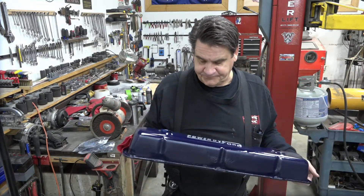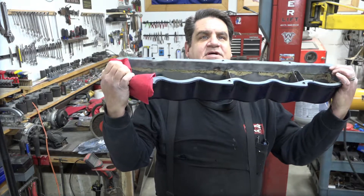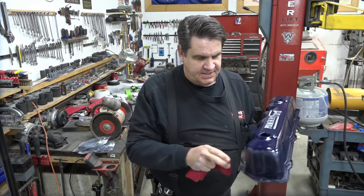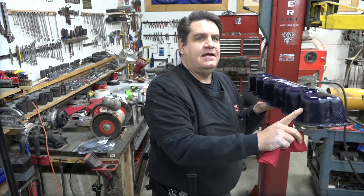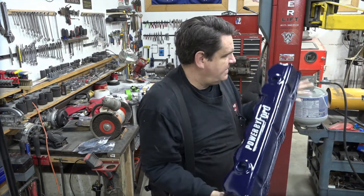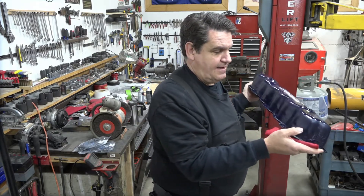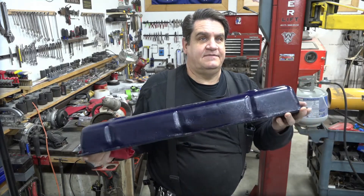To talk about how I did this: in the first episode, you saw how I braced it — I braced it from the inside — and of course made sure that it didn't leak. Then we just used an ever-so-slight bit of body filler to fill in any imperfections as best we can. Then I shot it with spray undercoating — just the sides; I masked off the top. That stuff dries really hard, kind of like a spray-in bed liner, and it goes on real thick and builds up, has a real high build to it, so it filled in the remaining imperfections.